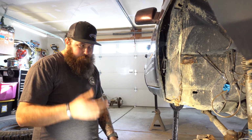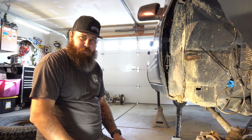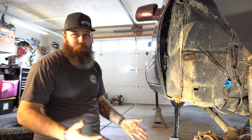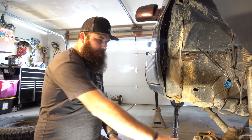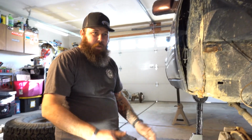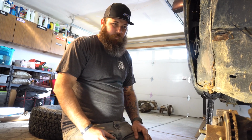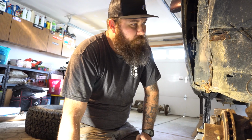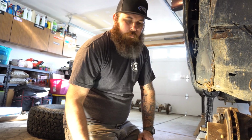If it's me, I'm gonna put a high pinion 30 in it because Rubicons generally demand a pretty high price, and I don't think it's worth it. So high pinion 30 all the way for us. If you're gonna go anything more than that, 1 tons, you know, 05 plus Super Duty axles and really get after it. But this will be more than enough for what we're planning on for this rig. So let's get that other brake line out and go from there.